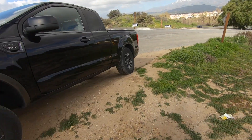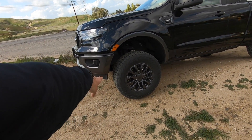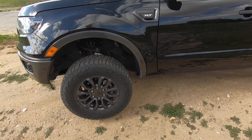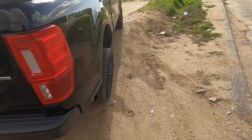Here I have like a twist ditch, so I'm going diagonal over this hump and you can see the front suspension is articulated fully - so fully that I can push it down right there and it's not even touching the ground. This side is fully drooped, this one is tucked up. What does the other side look like with the solid rear axle? You get a little bit of a tilt with the contact patch because it's connected in a straight line. You can see it's barely touching on the outside edge there, while this one in the front is fully on the contact patch on the ground and that one is compressed.